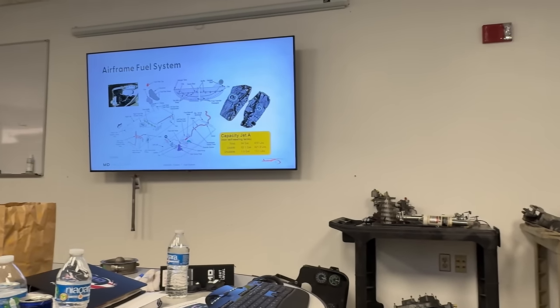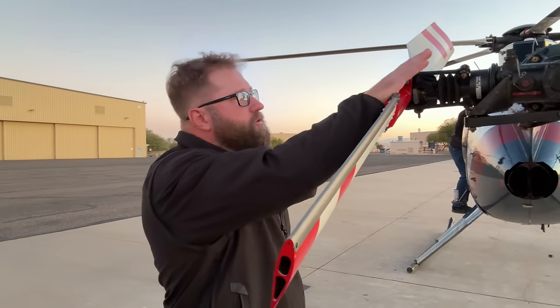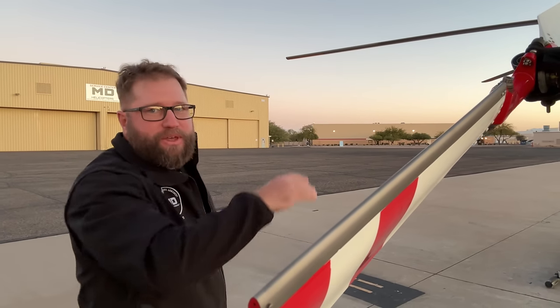The plumbing for most everything other than the vent lines is all in that left fuel cell. There's a check valve via the keel beam, in between the two. Parker's dropping some knowledge on us about the MD. One nice thing about this helicopter is there's no grease on the tail rotor — no grease on any of the components. So as this thing's spinning, we're not slinging any grease or making any dirt on the tail rotor blades. Same thing with the rotor head — no grease to clean up after a flight. The only thing you'll have is a little bit of soot from the exhaust, so a little soap and a rag and you're good to go. The tail rotor gearbox is in an oil bath — there's oil in the tail rotor gearbox and in the transmission. But the rotor head itself is all greaseless, really only getting dirty from the soot from the exhaust. Pretty cool little fact about MDs.